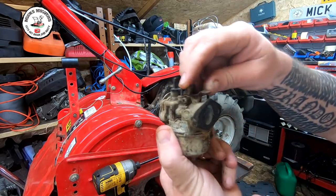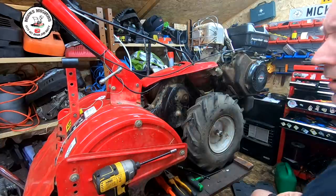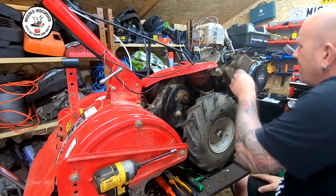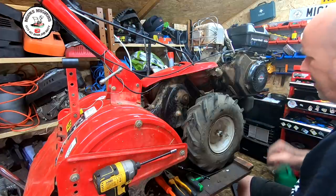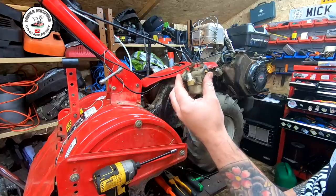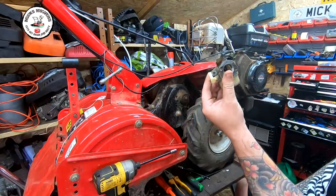The carburettor is in good condition, but the throttle itself is not actually running as well as I would like — it's stiff and should be a bit looser than that, so that's why it needs to go in the cleaner. I'm going to put a bit of paper into the inlet hole and get my air compressor going later for a bit of a tidy up. I'll probably have to remove some of this cowling as well just to get inside for a clear up, because it is particularly dirty all over the place with bits of sticks and all sorts hanging everywhere.